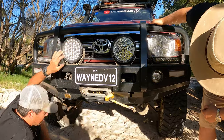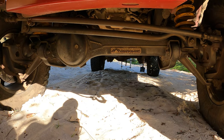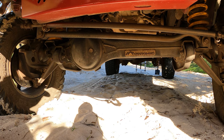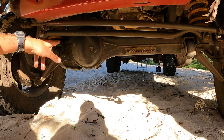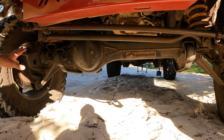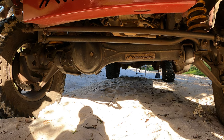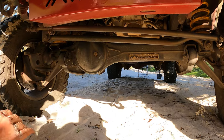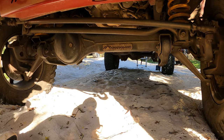I'll show you what the portal's all about. You can just walk under the car — you don't have to bend over — which makes it easy to service. Your axle runs through into the portal housing. When you go to Marks, they give you the portals plus all new bracing, fix the rear diff, give you a wider track, brake lines, diff breathers, and air locking hubs. It's a lot of work — your car will be gone about four to five weeks. And not only do you go higher, you go about 8 inches wider — so you'll be running a positive offset wheel.